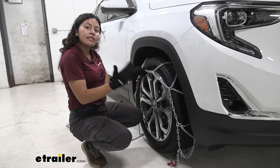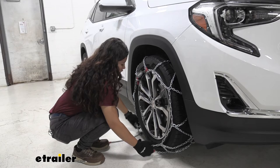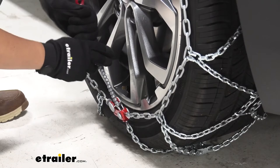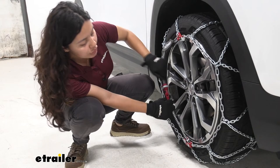Next, connect the two pieces in front of the tire chain — you'll know they go together because they're colored the same. That link fits into that hook, and then connect the ends on the bottom. At the bottom you have a long chain that fits into that hook; pull it as much as you can before connecting the self-tensioning system. This bungee-style hook comes down and connects to that loop — that's your self-tensioner, and it holds everything in place as you drive.